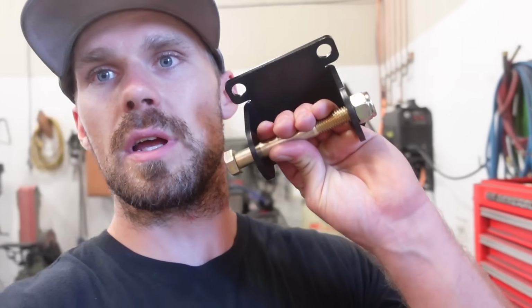One thing we do have to do still is the tie-ins for the roll cage. Basically I have plates sandwiching the body and then these bolt into some bushings that are welded right into the frame. So very, very strong. All I gotta do to tie in the cage is just 6 of these mounts that mount from the cage to the frame. The cage will be done.